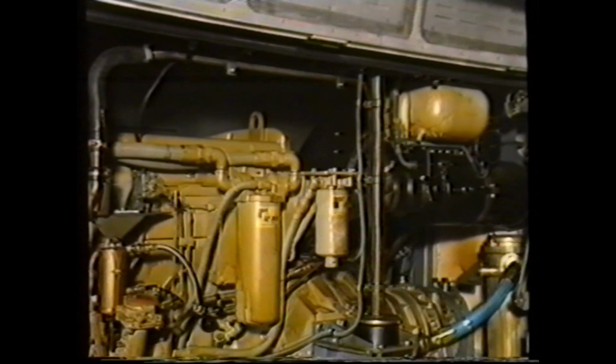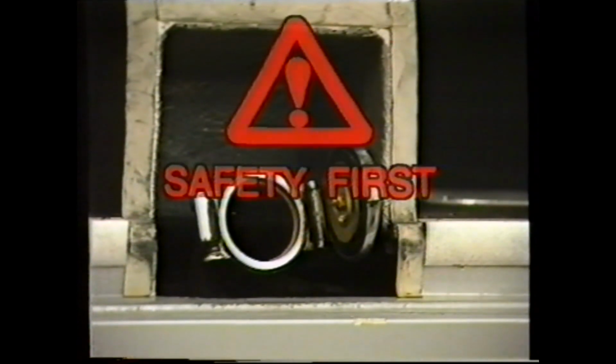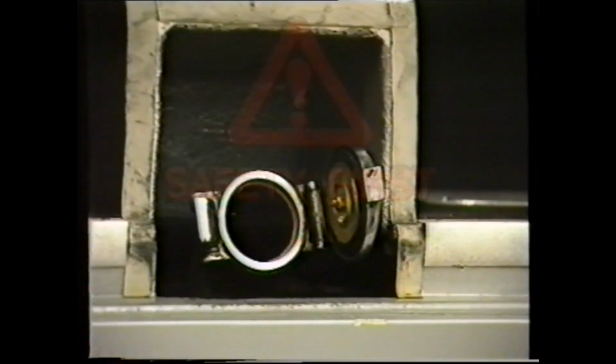If no air is evident, we should now check for pressurization of the fuel return line, as this can be caused by a damaged pipe or a faulty tank vent. In this instance, your first check will be to release the fuel filler cap. Take special note that if the tank is pressurized, fuel can be thrown out of the filler neck. Therefore, take precautions to contain this spillage. If the engine now responds correctly, the tank vent is at fault.